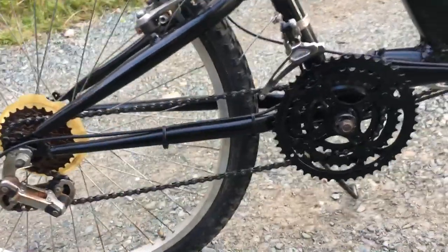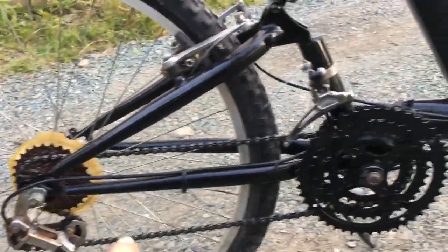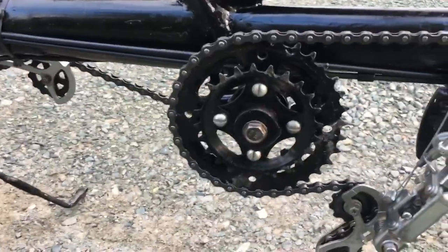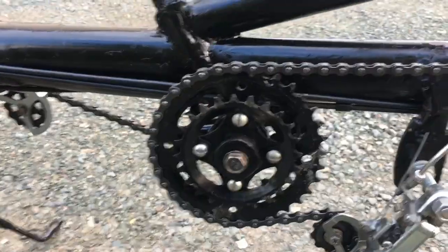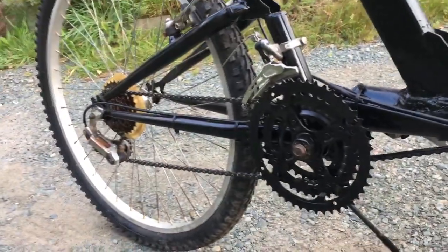On the other side, the rear chain is just like a regular chain. You've got three sprockets on the front here and seven here, which gives a total of 21 speeds from the original bike. But now since I'm driving that with a front chain, I have three here on the crank sprocket and two right here on this sprocket. This old derailleur is doing double duty as a chain tensioner, plus you can shift between the two sprockets.